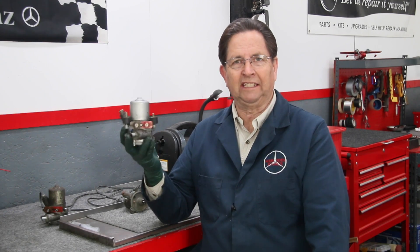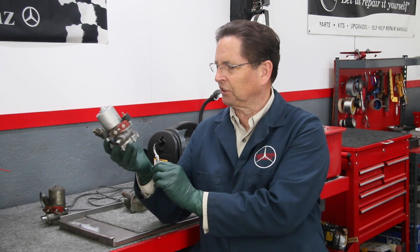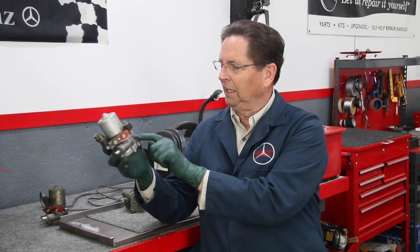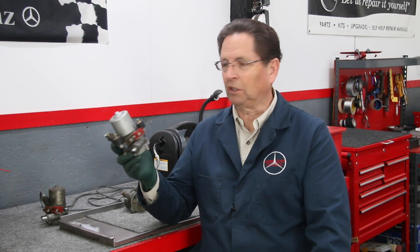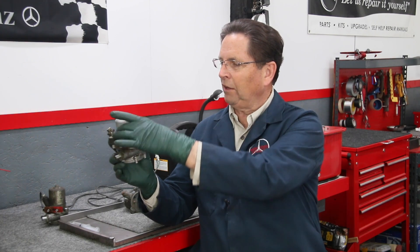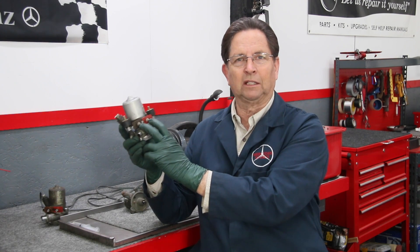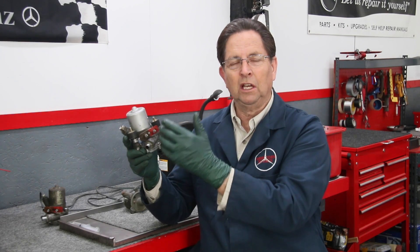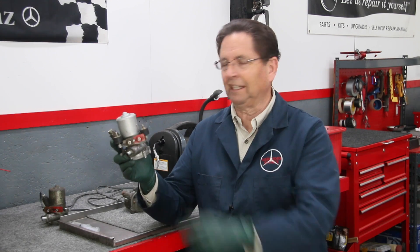If you recall last year, I did a kit to reseal the lower part of these pumps — that's where most of the leaks occur. They either leak out of this O-ring here on the bottom plate, or there's an O-ring separating the plate here from the motor housing. But there's also a couple O-rings in the motor housing, one right here on the motor cover, and then there's two O-rings where the electrical posts come out to make electrical contact. So I've sourced other O-rings for those particular leaks. Those leaks aren't quite as common, but if you're going to overhaul or reseal your pump, you might want to get into this upper section too.